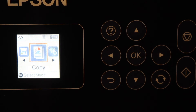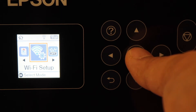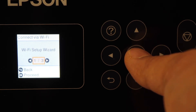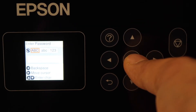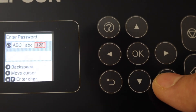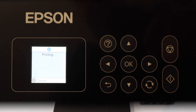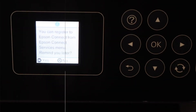For the Wi-Fi setup, scroll ahead, select Wi-Fi setup, and click OK. Select Wi-Fi Recommended and click OK to proceed. In the Wi-Fi setup wizard, select your Wi-Fi network and click OK. Now enter the password using the characters — I'll change it to numbers. Setup is complete, so click Yes.